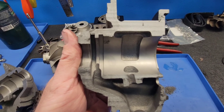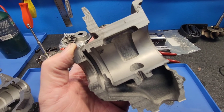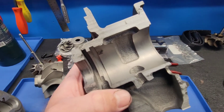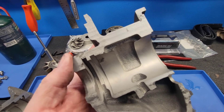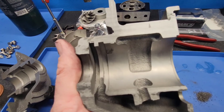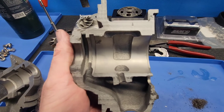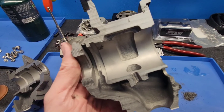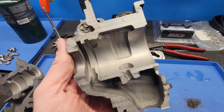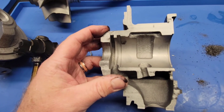I did a little measuring with this Garrett and I came up with about 13 and a half degrees. 14 degrees gets to the point where in a drag race application with the G forces of the car moving forward and some other things, you're going to have a hard time keeping oil away from that seal. I don't have a Gen 2 Garrett — I've got an S400 or a journal bearing turbo with a different type of seal structure. I cut the same thing open on an S400, S300, T4 Garrett stuff, and the numbers come up between 7 to 13 degrees. You can rotate it further back, but the consequences of doing it in the long term could get expensive.